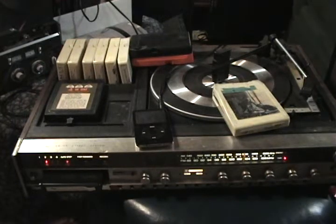They're not the perfect technology, they're prone to jamming and head misalignment. The tape also deteriorates. They actually coexisted with cassettes for a while. And then cassettes eventually took off. So they replaced 4-track tapes, and they are called 8-track tapes because they have 4 programs, each with 2 channels. So there are actually 8 tracks of audio recorded on the tape, which technically play simultaneously.